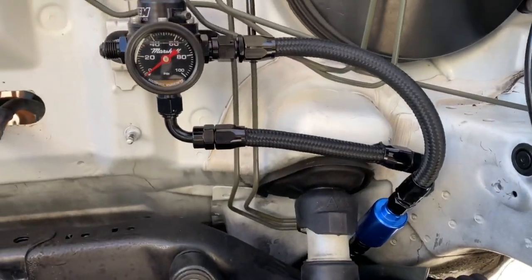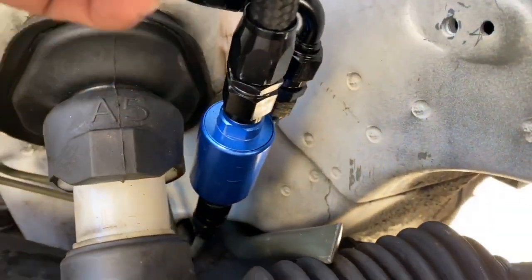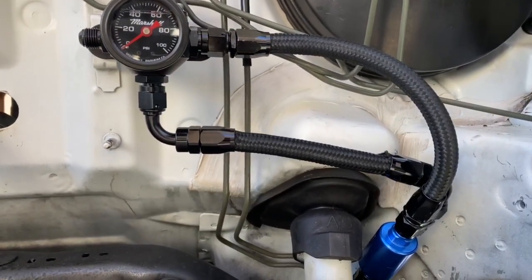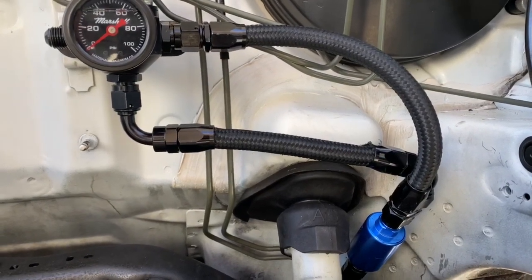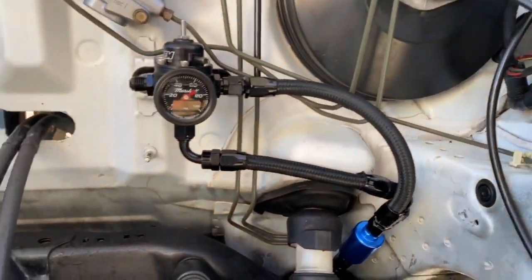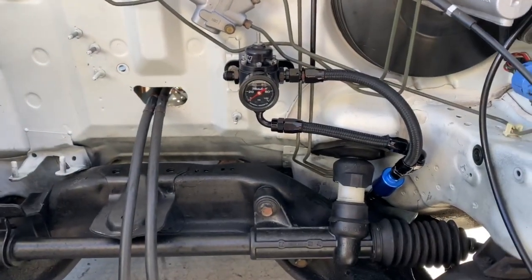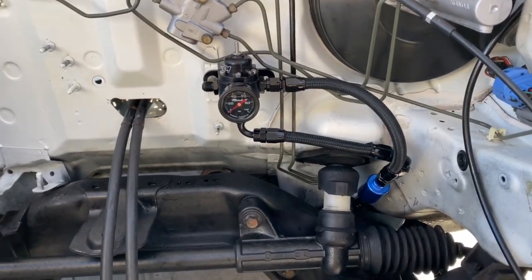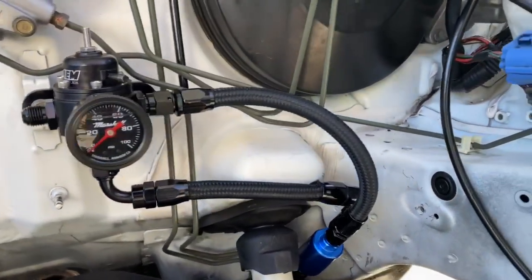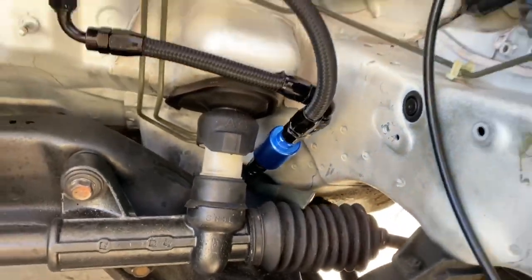Got the feed and return all dialed in. I went with two 90-degree fittings and tapped in right here for the return. Like I mentioned, on the return you don't really need the AN fitting because it's not a high-pressure line — I just chose to do that to make it look cleaner. The fuel filter is there and everything's hooked up to the fuel pressure regulator. Now I'll go from here, hook up to the engine — I'll be doing that last since I want a good measurement on the line. We still have to do the fuel pump and remove that vent line, so I'll be showing you guys how to get that done soon. Let me know what you think — comment and subscribe!